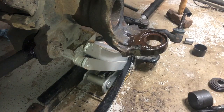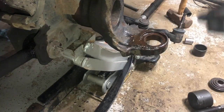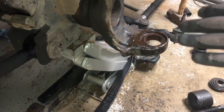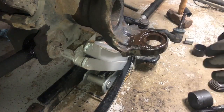We are finally to the halfway point — both ball joints knocked out. One thing that's really necessary to do now is to clean out the housing — get all the grime out. If there are any burrs or anything along the edges, they need to be cleaned off. It needs to be completely smooth and dried out, wiped clean. There's plenty of gunk in there. Both the bottom and the top have got to be completely cleaned out.